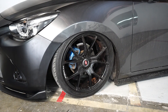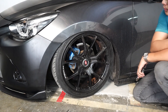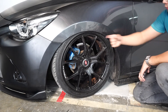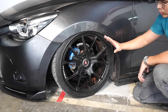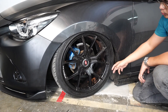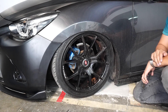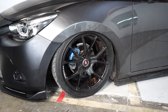Welcome to the front side of the car — let's discuss the fitment real quick. We are on coilovers, meaning we can actually adjust this further. But right now we have around 12 to 15 millimeter gap from the fender to the rim of the tire. Usually people really love the fender-to-lip look, but for the client, if he drops another finger, his lift capability will be compromised and he wants the air suspension to traverse multiple obstacles. So for now, this is our best fitment. At the same time, we need to reduce the tires from 205 to 195 — this is a 17-inch wheel. If we go lower, we're going to hit the fenders and he'd have to roll the fenders. One quick fix is just downsizing the width of your tire. For the front side, we can go lower, but not for now.